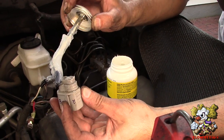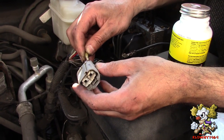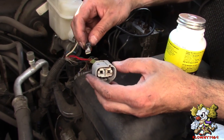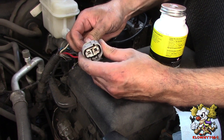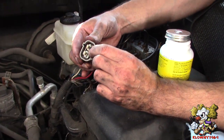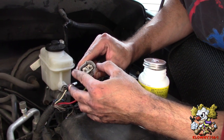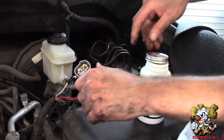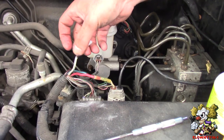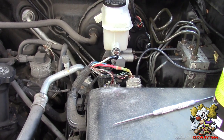We've got a new driver — install that. Now put this one in here; it's slid out still so you put it in from behind — and you hear that click. Now this one — that one clicked too. Tug on both of them and they're not coming out. Push this back in. Pop this in and you're good. This one here was the one I just cut — I put a cap on it and taped it, and spliced into that terminal over here. So we're all done.